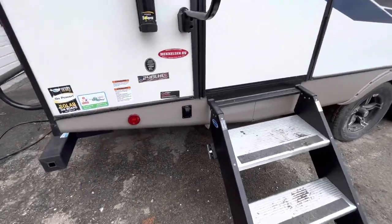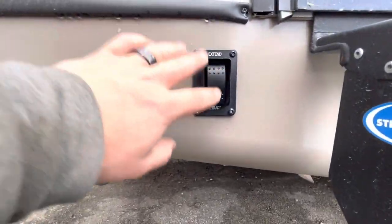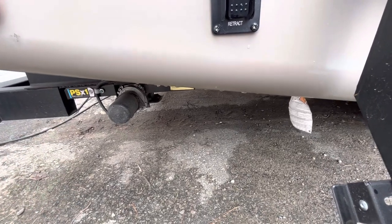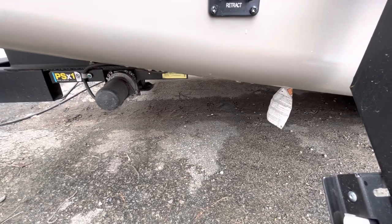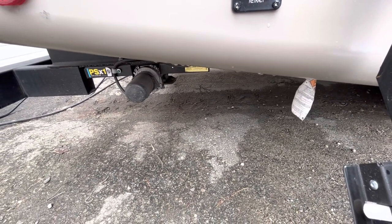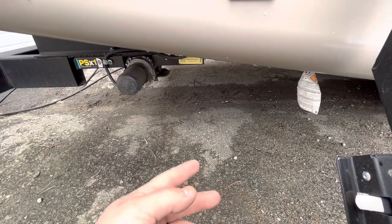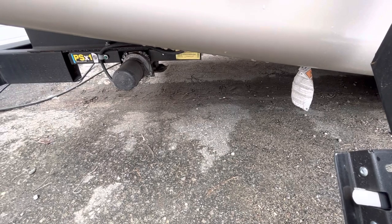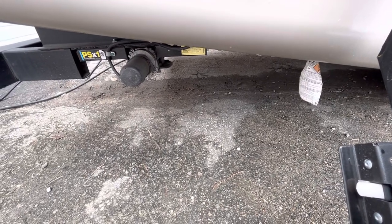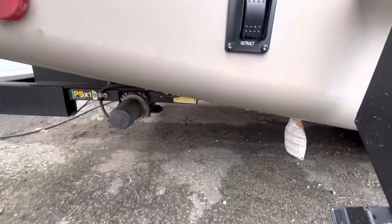On this side, right next to the entry door, you have a switch for your rear stabilizer jacks — these are electric, so you just have extend and retract. When you're extending them, once they hit the ground you'll kind of hear the motor wind down a little bit, and it might pick up on the trailer a little bit — that's okay. But you don't want to try and jack the trailer up with these. They won't level it either, because they kind of pivot — if there's pressure on one foot, the other side will start to go down. They're only made for stabilizing, so if you try to pick this up with the jacks it will bend them. Just be careful: once you hear that motor start to wind down, let off the switch and you're all set. You have the same switch up front — same thing applies.